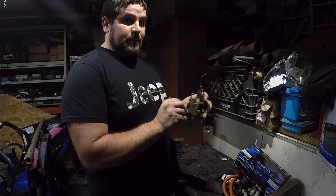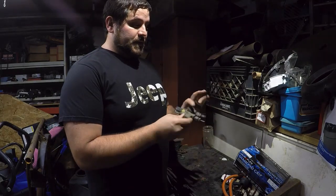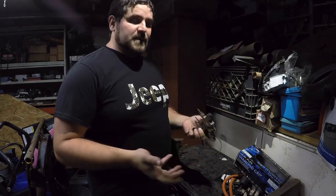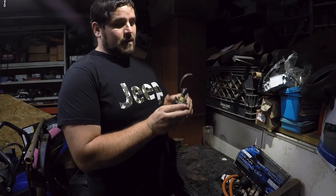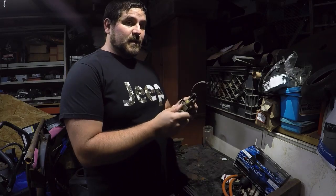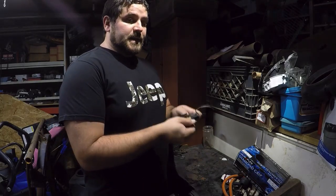I'm going to show you how to take it apart and clean it. On my '93, I put all new brake lines on last winter, and when I went to go bleed the system, I couldn't get any fluid to the rear. It was because my proportioning valve was junked up with bad, cruddy fluid. My lines are rusted, so it backfilled into my proportioning valve and even to some of my reservoir. I decided one night to pull mine apart and clean it, and it actually fixed it. For you folks that seem like they're not getting pressure or not getting enough pressure to the rear, you might just need to take this apart and clean it.